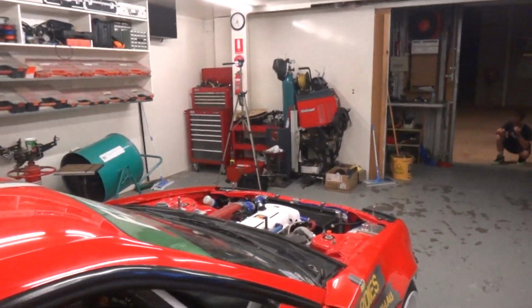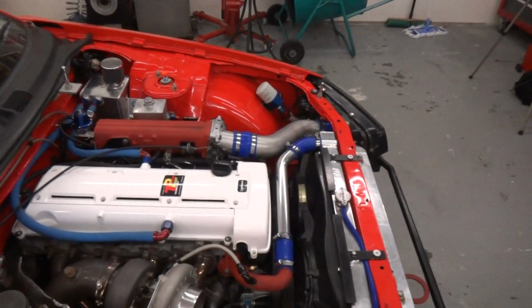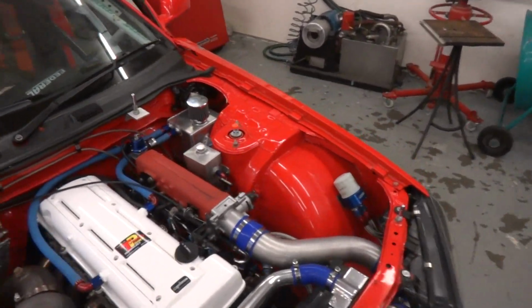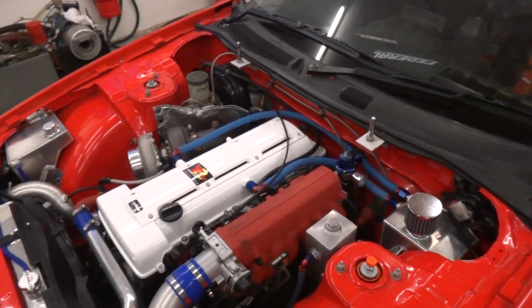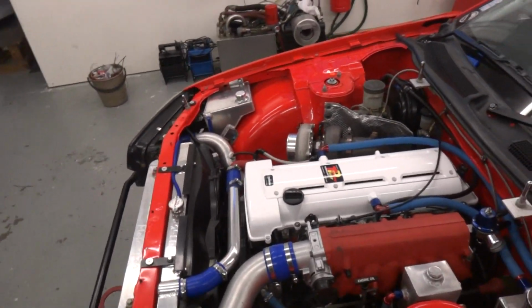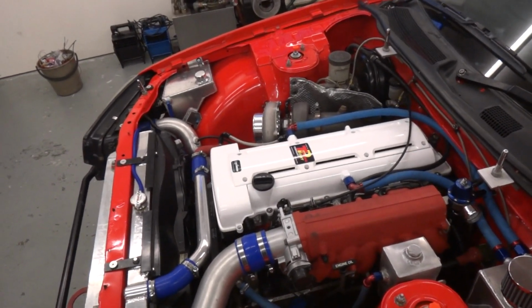We're logging fuel pressure and oil pressure. We have a cutout configured in the ECU. If the oil pressure drops below a certain threshold above a set RPM, the engine is limited to 2000 RPM, so as to minimize any damage.